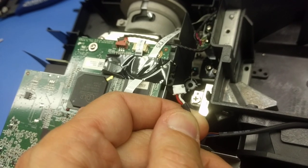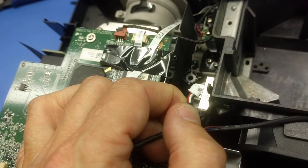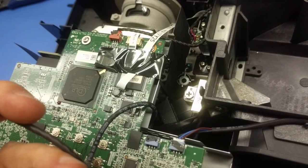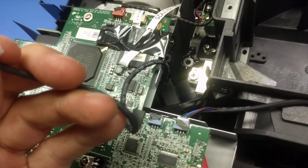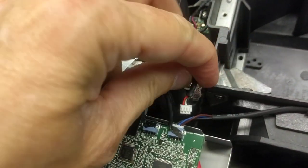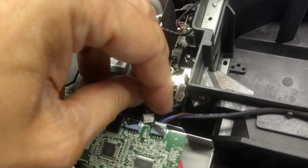And indeed, what happened in this case of this projector, is those contacts were pulled out and the crimp inside did not grab the wire adequately. And so what this leads to is a problem where intermittently the blower won't work. And of course that compromises the bulb, and it gives you the over temperature error, and it gives you a projector that then you need to send back to Optoma, either under warranty at your own expense, of course, or you get the RMA form and they tell you that for whatever reason this is damage that you caused, and now you're stuck for a couple $100 of repair and the return shipping cost as well, per their terms.